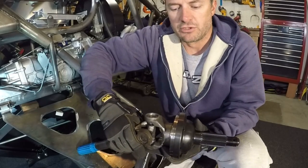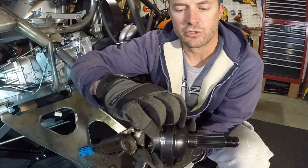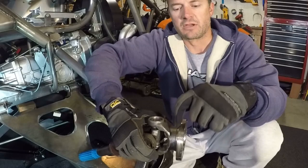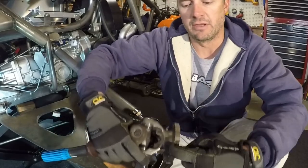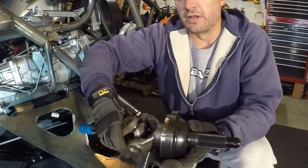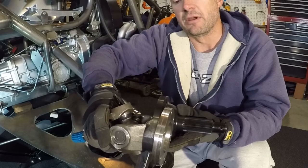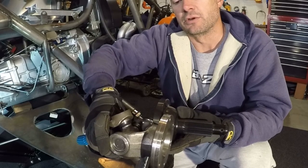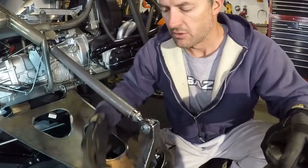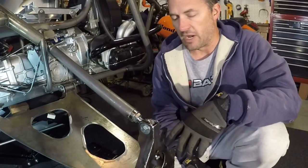What I'm going to try — and this is pretty experimental — is cut this cup off around here, then cut this adapter probably somewhere around here, and then weld those together. What I'm hoping is I'll be able to take this from being like this to maybe about like this, which should significantly shorten it up, bringing my u-joint pivot points closer to the pivot points on the spindle and the control arm.